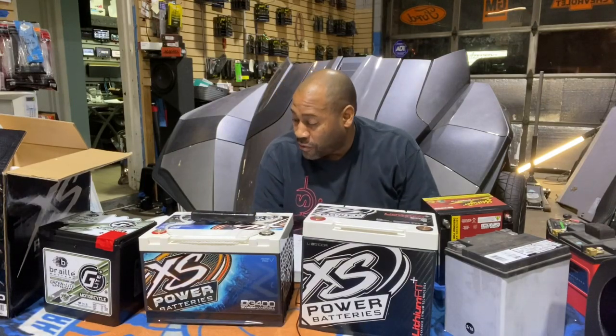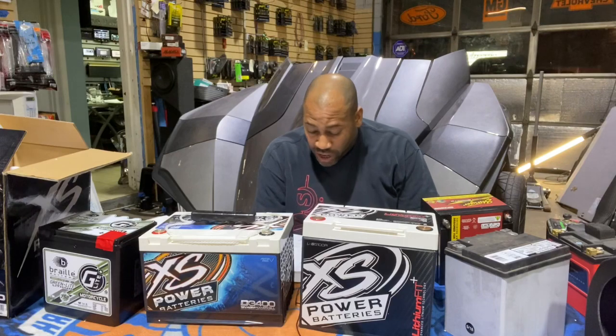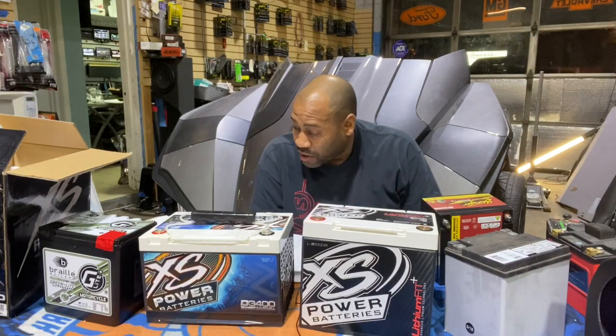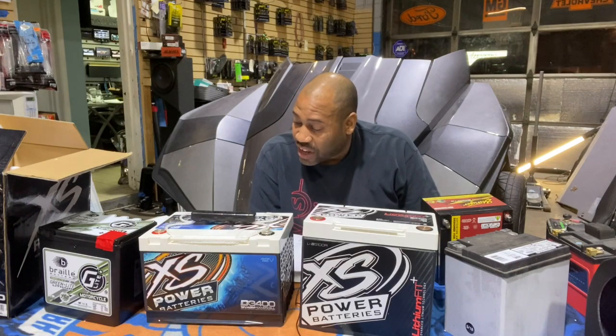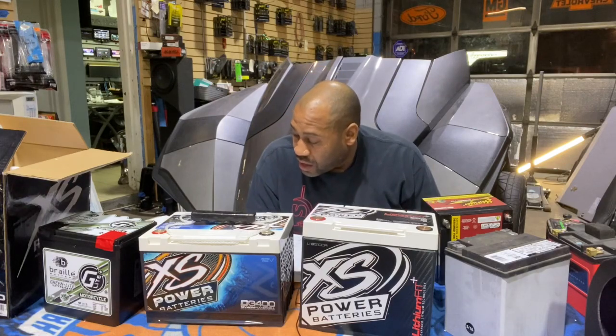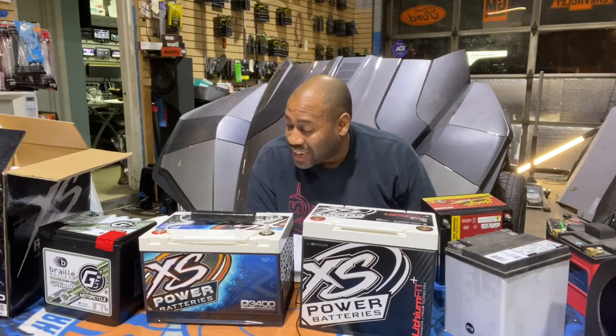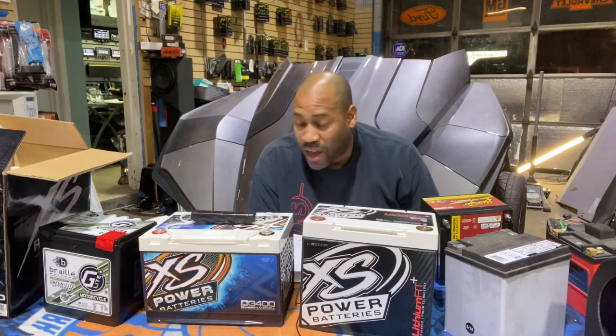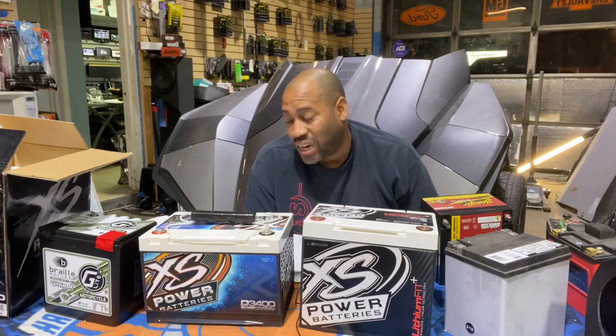So you have to be careful with companies like Shorai. Their battery, the LFX36L3BS12, which is their Harley-Davidson battery, claims to be a 36 amp hour equivalent, which nets down to 12 amp hours. That's why the battery is $329. There's nothing wrong with the battery. You're getting a really good battery. We've used this battery. There's a couple of bikes out there with the customer supplying the battery, running these batteries.